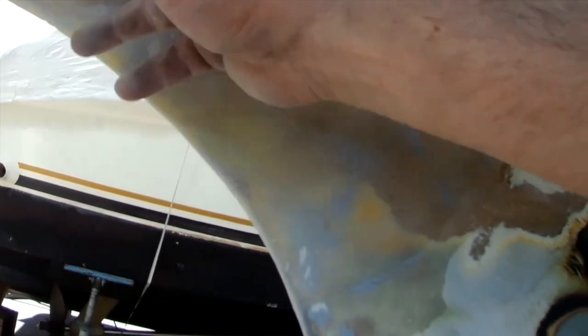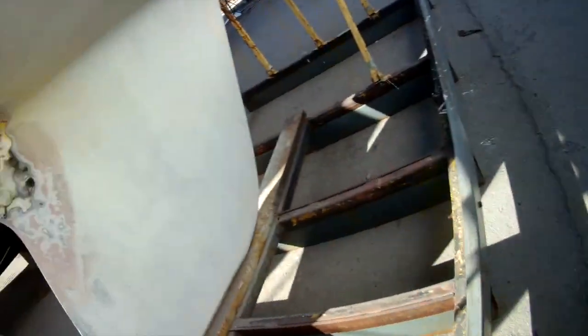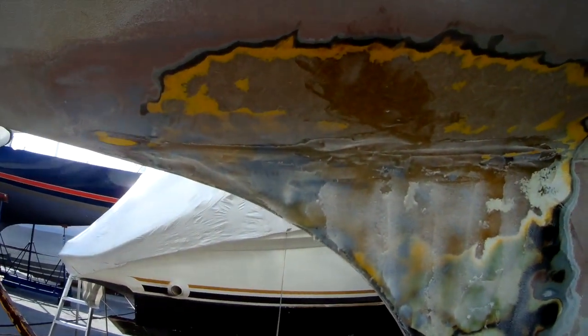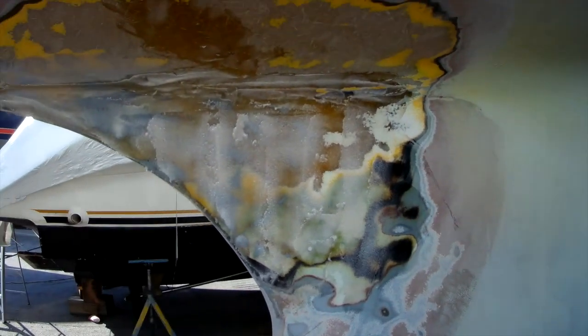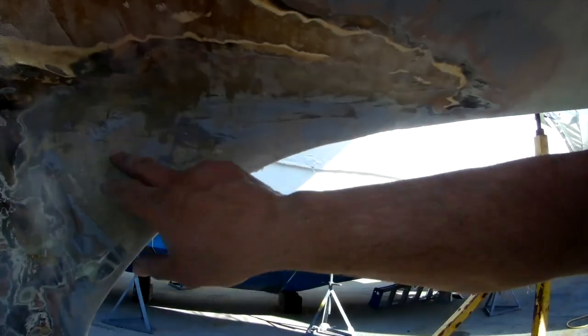I've ground it down to the bare fiberglass, so I'm going to put another layer — a bigger layer — all around this. There are four layers already there from last year and they look like they're holding well. Same with this side — there's a bit of old gel coat, this is where you put the grinder through. But there are no more cracks, so my repair from last year held. This year it'll be smoother — I just applied a really thin coat to fill in some of the gouges from the sanders.